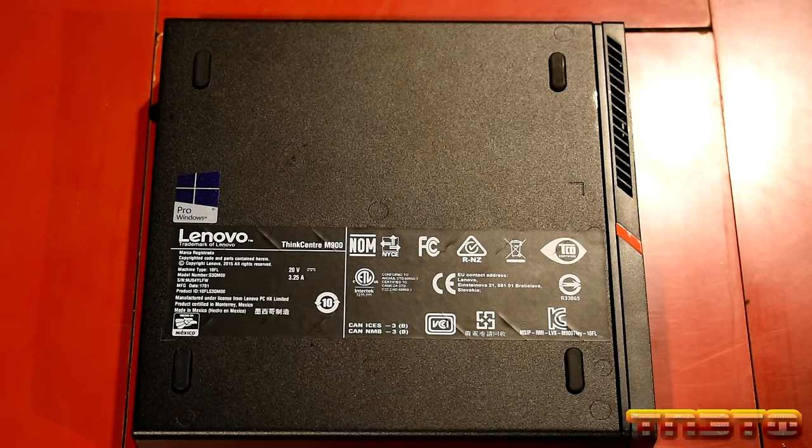There's our RAM. 32 GB of RAM. Our SSD, Samsung SSD 970 EVO Plus 1 TB. Our Ethernet. There's our Intel NIC. And that's another good thing about these units. They use Intel NICs. And if a unit has Intel vPro, it has to have an Intel NIC, and it has to have a proper Intel Wi-Fi card. Just to note. GPU. Intel HD Graphics 530.